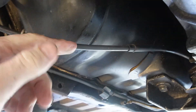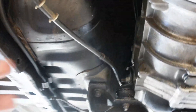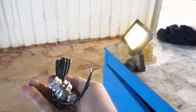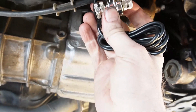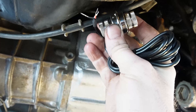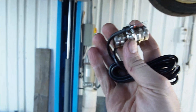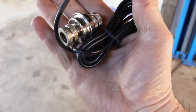There is a metallic sleeve with a plastic cover on it and there's a springy cable that goes inside. What we want to do — and I'm going to do this on the car without removing the cable — is get to the little drive in between. This device here will go in line with this cable. You cut a piece out of the cable and insert this, and the cable drive still goes through this device and along the cable all the way up to the speedo, so it doesn't interrupt your mechanical speedo drive. It then outputs a signal wire as well.